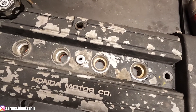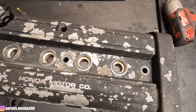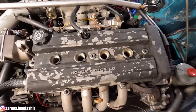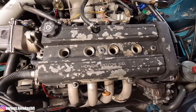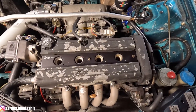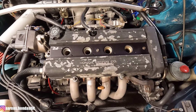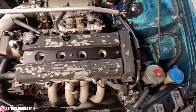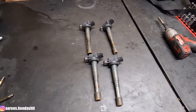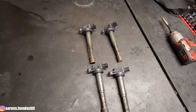I'm going to get this thing back on the car and put all the bolts in except for these two, and then we're going to figure out what kind of hardware we need to mount the coil plate permanently to the valve cover. Here is the valve cover mounted back on the engine with no hardware in these two holes. I'm going to put the coil plate on now and try and find a bolt that'll hold it down from my bucket of random bolts. I found two bolts that I like the length of that mount the coil plate down as well as the valve cover. The coils I'm going to use are coils off an S2000 — they're the same as K-series coils, same part number — and I'm going to drop these guys in and see how well they fit.